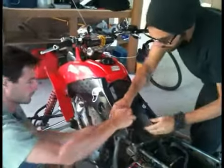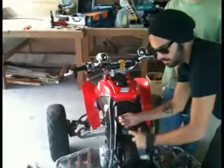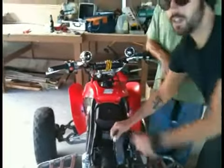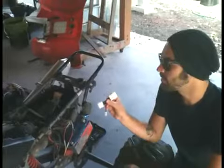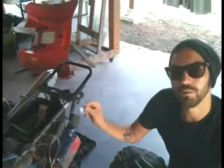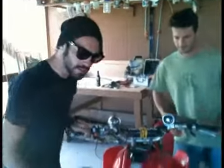Now we're running the wires back under the frame where we'll connect them together — from the speakers and the volume control over to the amp. All right, we're going to tie it all together now. We're going to plug it into the volume control right here; it runs back to the micro-amp. Then we're going to run the power from the speakers and plug it in right here. Easy, done. Next step is hooking it all up to the battery. The kit came with this standard American battery harness. If your bike is metric and you don't have that, it came with these two little options here to hook them up to the terminals real easy. All right, we got everything hooked up. Battery's all ready to go. All we have left to do is clip some of these ties and turn it on to see if we're live.